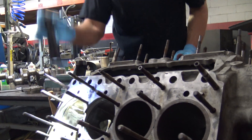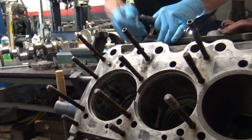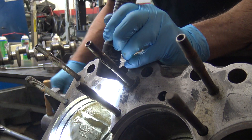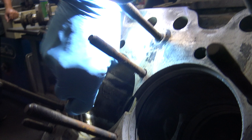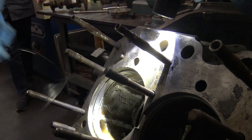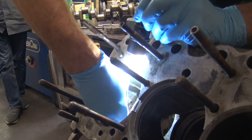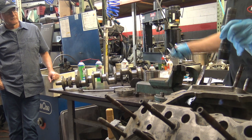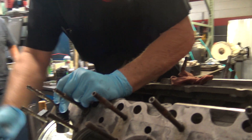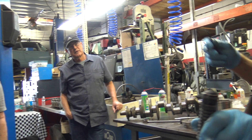If you look inside here you'll see that there are some O-rings in there. This is a really clean block, to be honest with you. The upper one is small — you guys can see that — and that traps the coolant to keep it from going around. Down below is another O-ring, and that one is kind of oval, kind of flat and wide — that keeps the coolant from going down. And then there's one more O-ring if you look in here, which is the same as the other one, and that keeps the engine oil out.